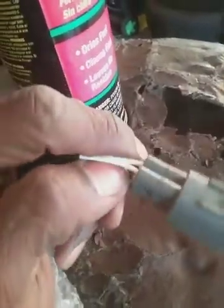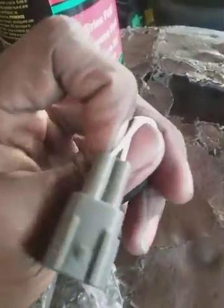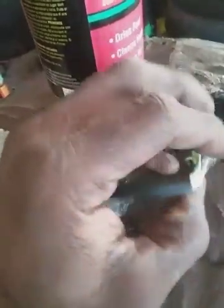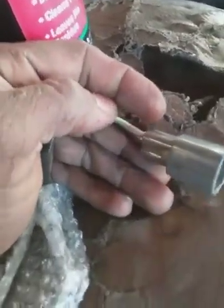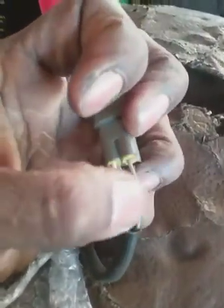While that's warming up, I'm going to show you how this sensor is typically made. It's a four-wire sensor down at the bottom of the Integra — it's an OBD1 system. The two wires that are alike are always going to be your heater wires. You're going to have a 12-volt feed and the one going to the computer system that's going to regulate the temperature. You're also going to have a ground and a signal wire — the two other wires. The sensor is grounded through another source. You're going to have a ground, a signal, and a reference wire. The reference wire is what I'm going to be hooked up to when I start checking it, but I'm on the signal wire for the heater at the moment.